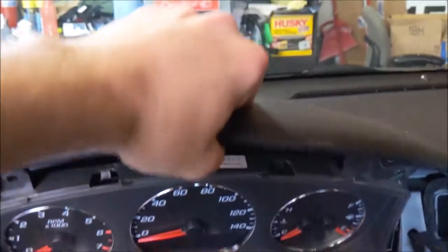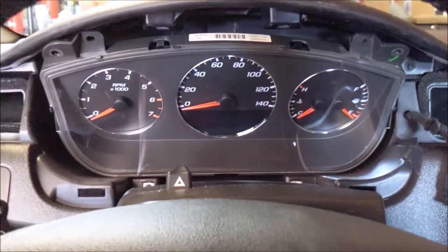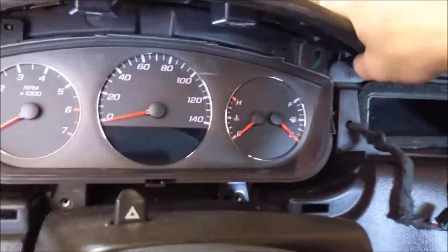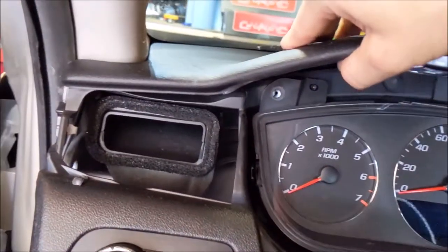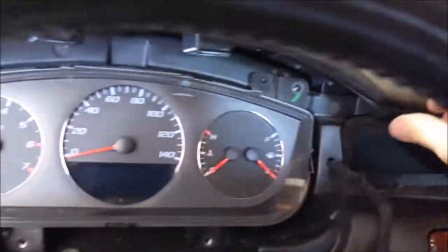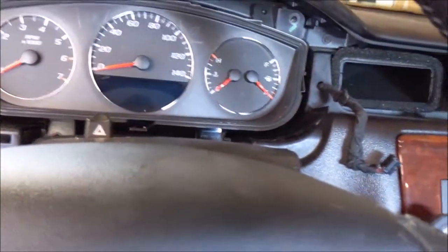So now this. Doing this single-handed again, you're going to want to lift up on this dash pad a little bit to snap that back in there, which I'm going to do two-handed. Trust me, that's what you're going to need to do. All right, just FYI, you can snap this dash up a little bit. It snaps, then you can get it in. Maybe that'll help you get it out, and then you can snap it back down, and we're good.